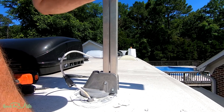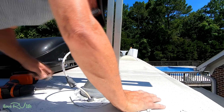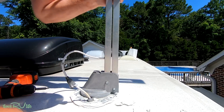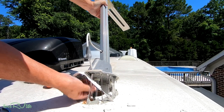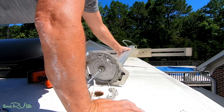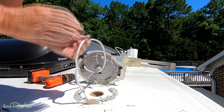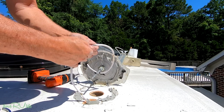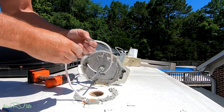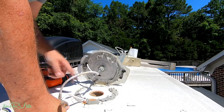I'm going to take this paint scraper and go around the bottom, just loosening up this lap sealant, being very careful not to push into the roof — keep it very flat as you push so you can just release that bond. Here's the end of my cable and this is the coax connector. Look at that thing — it is so loose. These things aren't worth a thing. I'm going to replace all of those. Let's clean this up.